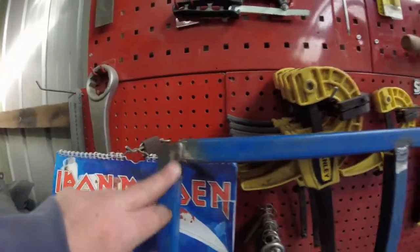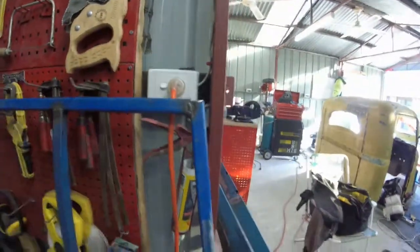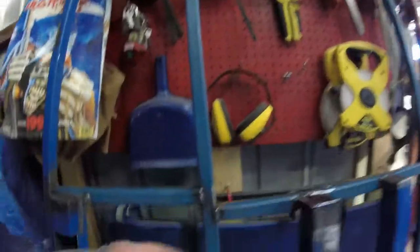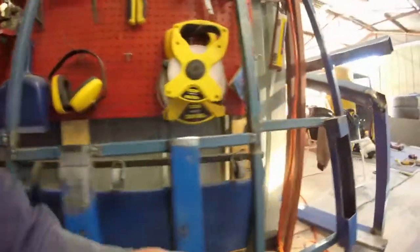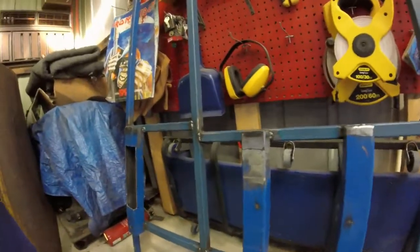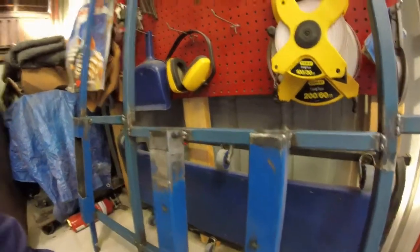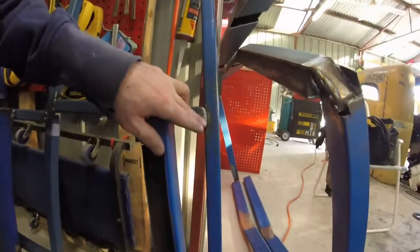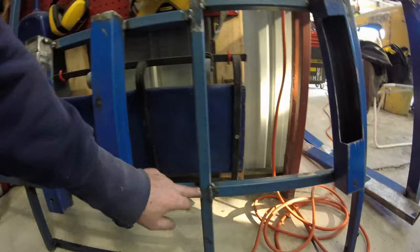The other thing I should have showed you too was the floor. As you can see — nice welds. One dodgy weld which was this one — it's almost like two tacks. But I'm pretty happy. As I was saying, I'm getting to learn all about my welder now. They're good flowing welds, didn't blow any holes in anything. Got the wire speed correct and the heat/amps all sorted.